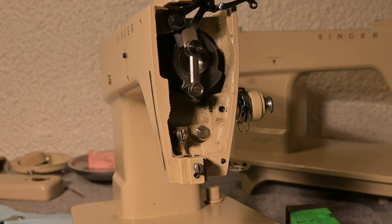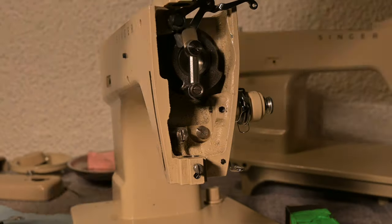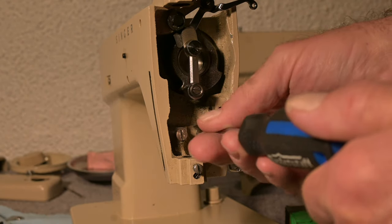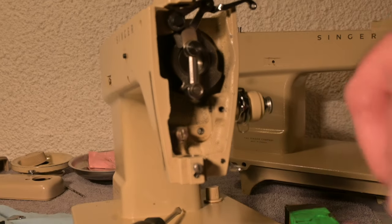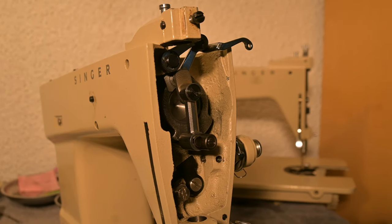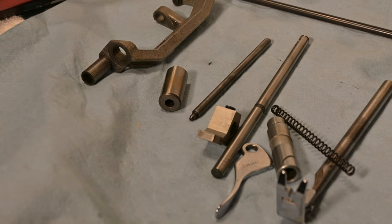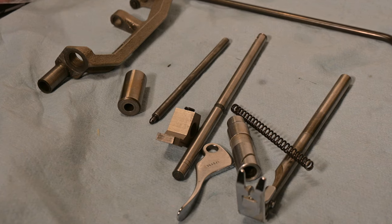What I'm going to do now is get this on, and that is the screw I've got to take off to get this on. I'm really enjoying working on these machines that have been cleaned — they come in real grubby and then they get nice and clean. Starting tonight at Jeb Adams Studio — what a great place to be. What I'm looking at here are the parts for the front end: the presser bar, the needle bar, the swing arm bar, the zigzag bar up there, and the lever and the bushings and all the pieces. There are quite a few pieces once you start putting it all together.